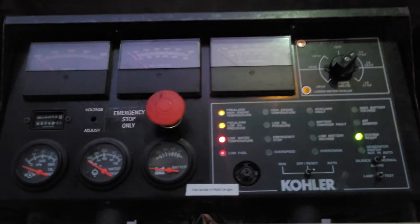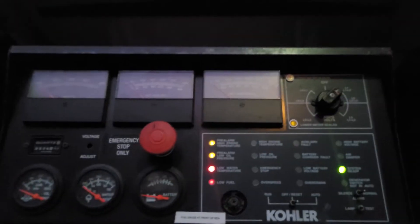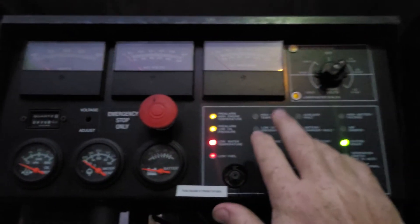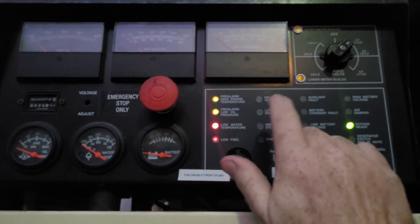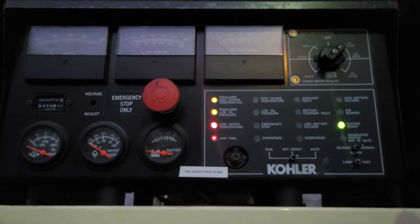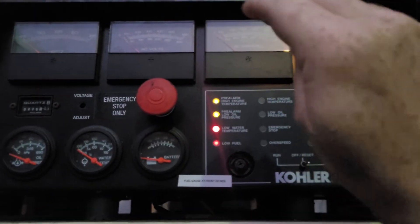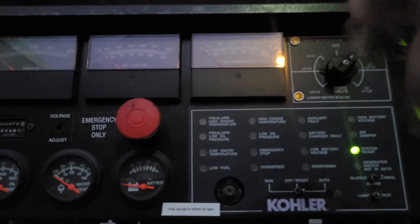Don't mind me — we're at the gates of hell, so that's why you hear all the noise in the background. What's happening is a common problem: the diodes in the indicator board are starting to go out. There are sometimes quick fixes that will get them down the road temporarily — there you go, fixed.